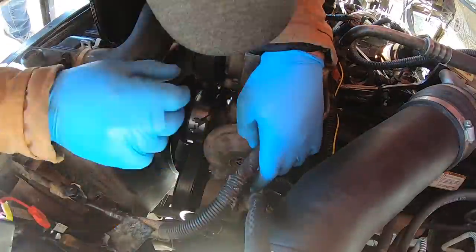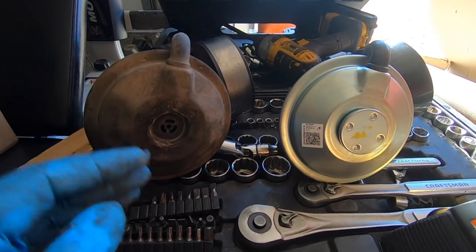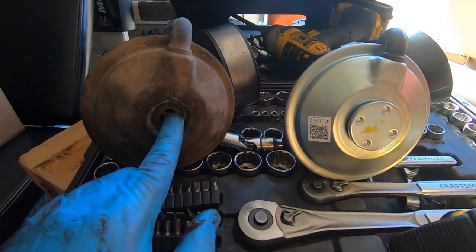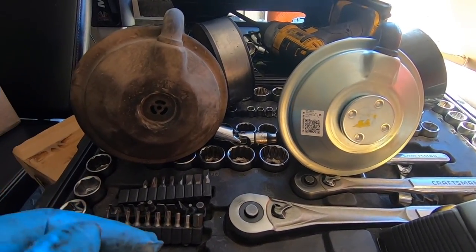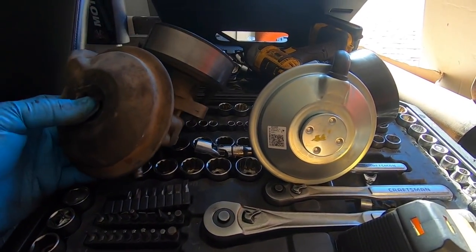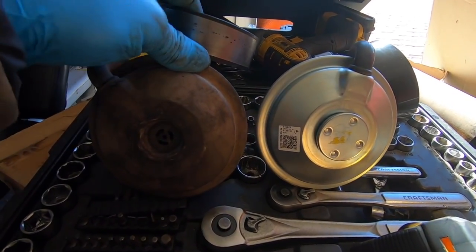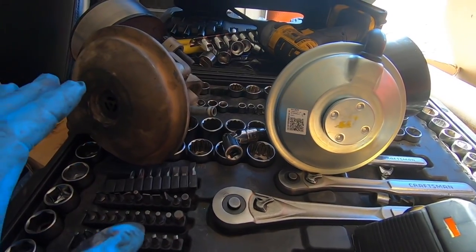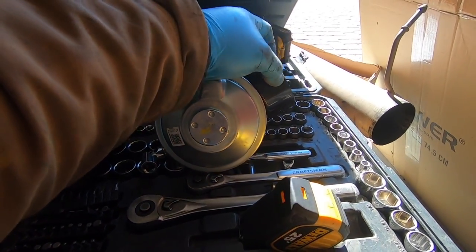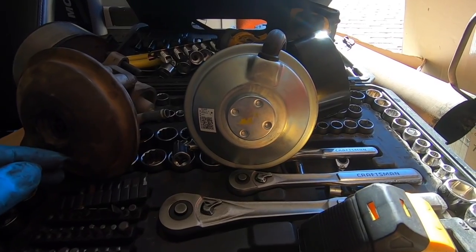Here we have a quick side-by-side comparison of the old pump versus the new one. You can see my old one has this little cap missing from it, and I think that's what went wrong — that's the only thing that looks bad. If you spin the pulley, with two hands you can spin it all the way around freely, which pretty much shows it's not creating vacuum, or at least not enough. On the new one you can't really turn it, because the cap is probably holding the vacuum in there.